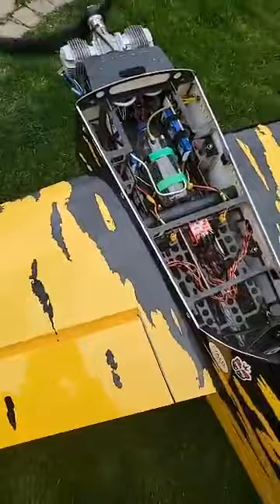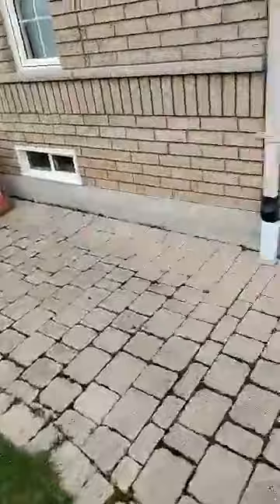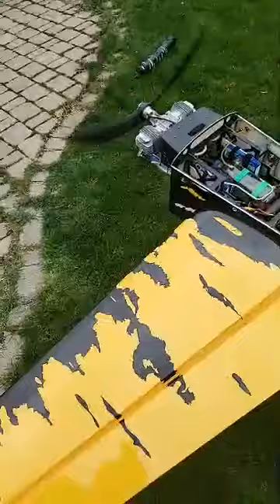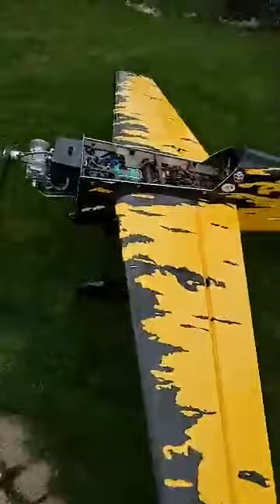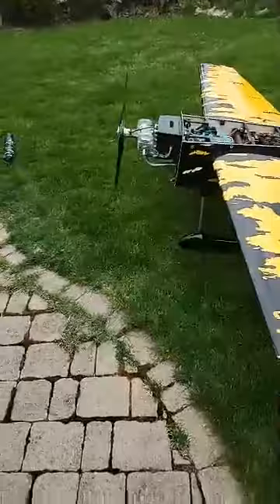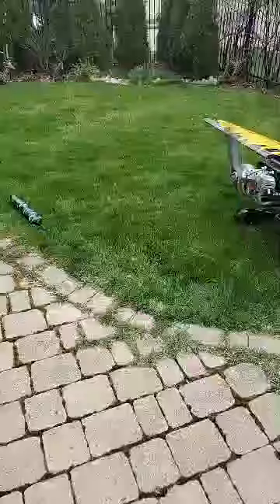On this plane too, we experimented — you can see an aluminum overflow coming out of the tank. There's also an aluminum fuel line that runs through the floor of the engine box. The fuel tubing I use between the tank and that aluminum fuel line is about 3 inches, and the connection between the engine and the aluminum fuel line is about 2 inches — just enough to give it a little flexibility. I'm experimenting with aluminum fuel tubing instead of running fuel hose all the way. We all know how expensive Viton tubing is, so if we only use a little bit and use aluminum which is a lot cheaper, we can stretch the value of that Viton.